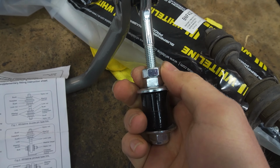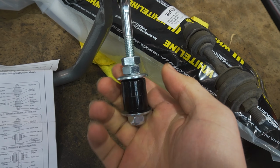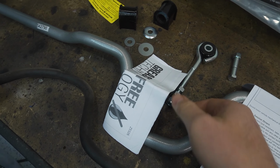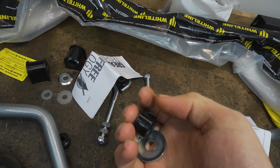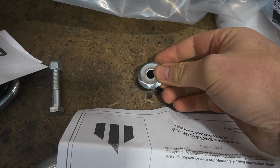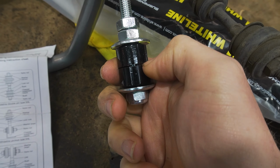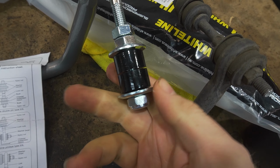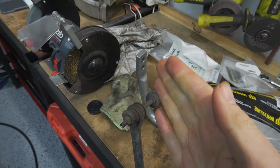And at the bottom, you're going to have your two locking nuts at the top here, followed by one of these cone washers. These washers are tapered like this. And as you can see on the bush, there's also a taper. So you need to make sure that the tapered part goes underneath the bush like this. So you'll have them looking like this, and the actual lower control arm mounted in the middle here like this. So that'll just be replicated on the other side of the arm.